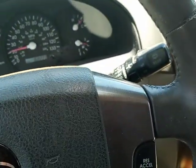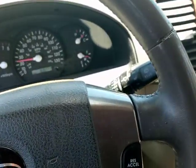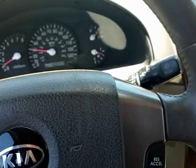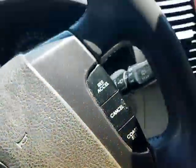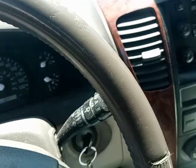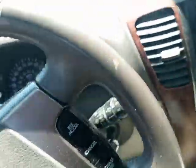Doesn't feel like it's missing. Only when I step on the throttle just a little bit, I hear a little hesitation, but only when I rev it is when you feel it. Okay, so due to that the customer did timing, and you know me, I already did the checks. Coils are okay, spark plugs are okay. So what happens in this situation?